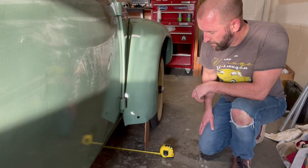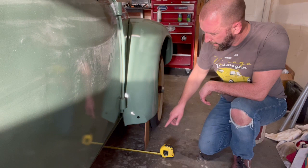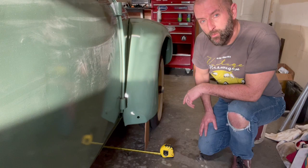Now I'm here at the back of the tire. Same process — I have a piece of cardboard lodged into the outermost tread and to the other side with the tape measure. I'm measuring 54 and a half inches here, so I'm about two inches different, with the rear of the tires being two inches wider than the front. So I have a toe problem. Let's take a look at how we adjust that.